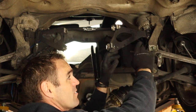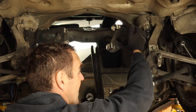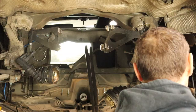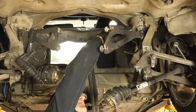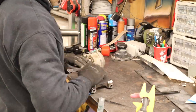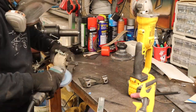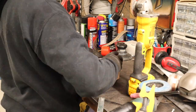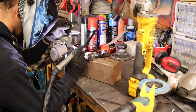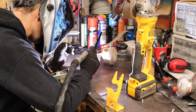The priority is altering this bar. What I'm going to do is take the mounts off, cut them, and lower by about two inches. The reason I need to lower these gearbox mounts is because the Audi engine sits about two inches lower in the car than the original Boxster engine does. That's just a clearance issue — to get it to sit nicely, you need to lower the gearbox down to get it to sit flat. There's still plenty of travel in the drive shafts.